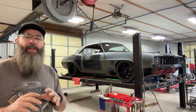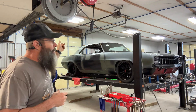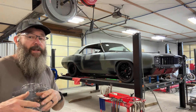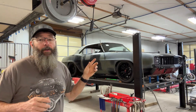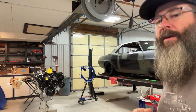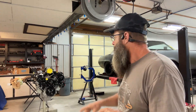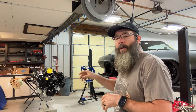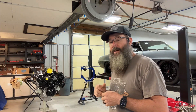Just a quick rundown on some of the things that are left to do on the car. Earlier, I did mention the flush-mounted glass — I do have the back glass. That's some of the stuff we'll be working on in this video. Additionally, we're going to be tucking the front and rear bumpers. I've never done those before on a car, so it's going to be somewhat of a learning curve. Also, we have the engine sitting here behind me — an LS3 that comes in completely dyno-tuned from Blueprint Engines. I have to change the oil pan on that, so I've got the oil pan ordered. I want to fit the engine and transmission — we were going to run a 4L80 in this car, but now we're going to be doing a T56. So that's just a few of the things we have yet to finish up.